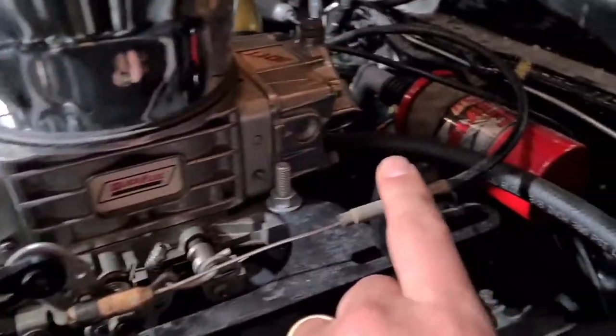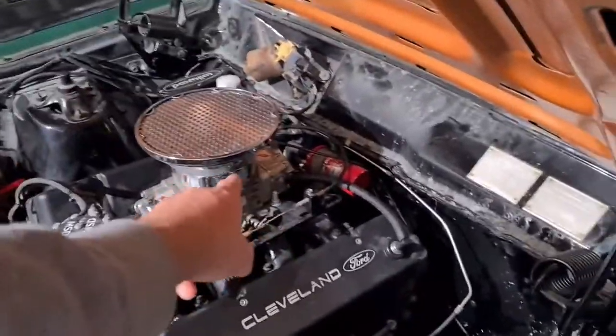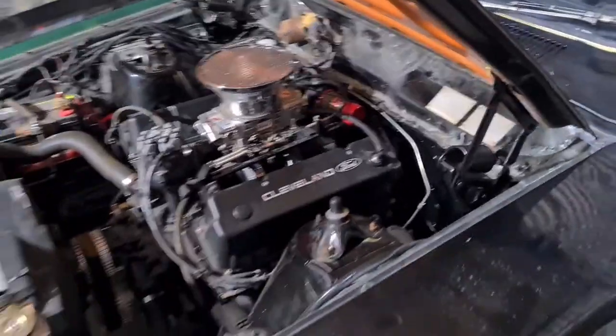From there you can fit it. Hope that helps you guys out — tidy things up a little bit. It's a bit shorter than the six cylinder one, which is what I'd rather. It doesn't have to be critical with those measurements because you've got an adjustment on your lock nut and also adjustment on your slide if you're using this same sort of setup. I'm pretty sure the Quick Fuel carbies are the same as a Holley. Hopefully that helps you out guys. Remember — have a go, have fun, and I'll see you next time. Cheers.